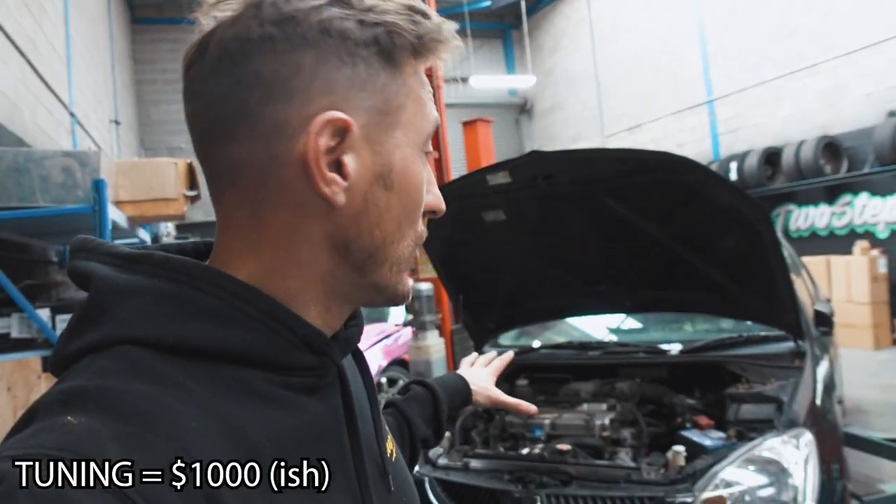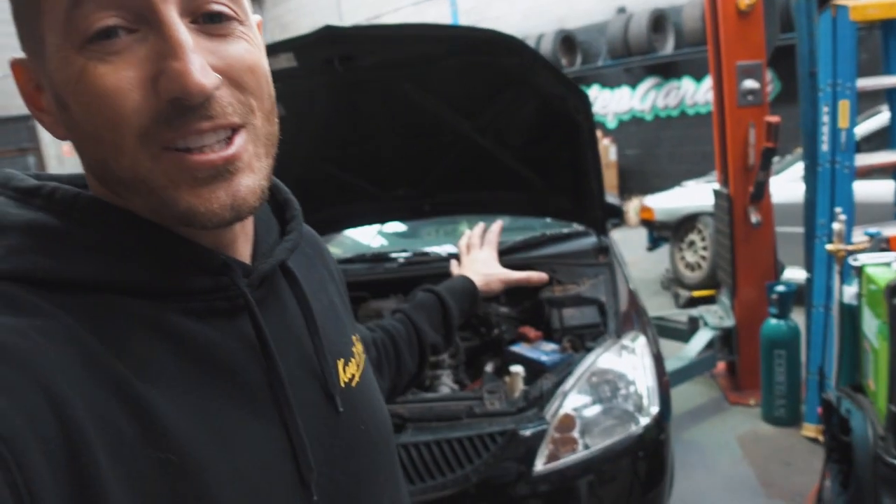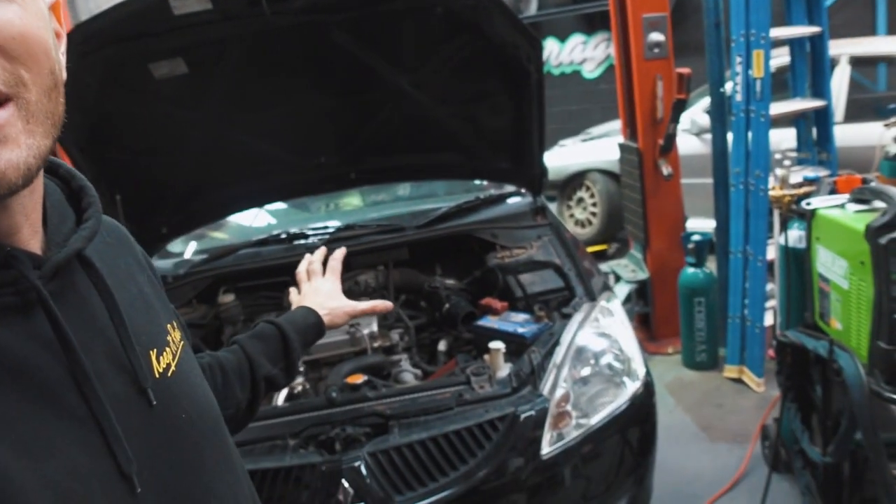The next thing is a big one — getting your car tuned. Luckily the best thing about these cars is the stock ECU is tunable if you have the plastic black cased ECU. You will need tuning files and definition files for the ECU so that your tuner can tune it. If you've got a Tactrix cable and the Tactrix lock and a bit of experience, you can tune them yourself, but it's highly recommended that you put the car on a dyno. The most difficult thing is finding a tuner who wants to work with and tune these things. I had to troll forums for hours and hours to find the right definition file for my ECU, but I've done the hard work for you — it's in the link in the description in my Dropbox. Do get a tune because if you don't, your motor will run like crap. It won't run properly on those 550cc injectors, and if you try to run the car on stock injectors it won't last very long at all.